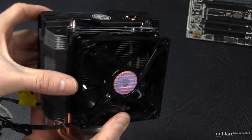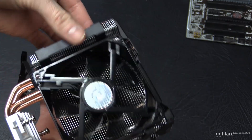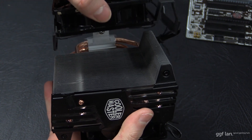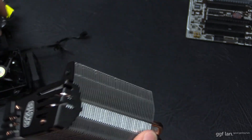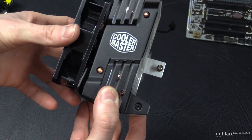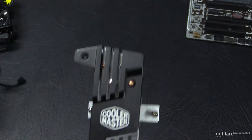The first thing I noticed with these fans is a new fan clip design, which I really like. A lot of coolers out there have wire brackets that you have to fit between the fins, but with this new 92mm design, you simply open the plastic clip on one side and then do the same on the other, and the whole fan assembly just comes off. I do like this heatsink design as well — it's not square. They've extended the heat pipe, so with the fan on it's about the same width, but without it's a little bit skinnier.